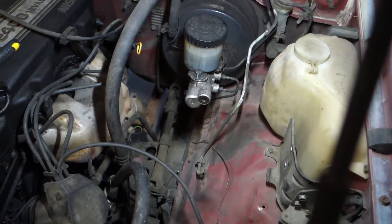You can see that orange portion right there where it goes into the exhaust. Now you can cut that and crimp it, or you can take that nut out of there — I think you can put like a nickel in there. On 240SXs it's about the size of a nickel. Shove a nickel in there and just run the nut back in. The trick is getting the nut off the pipe though — you have to cut it so that it's round so you can slide the nut off. I think what I'm going to try to do is take that nut off, put a nickel in there, and put the nut back in. It doesn't seal up perfectly but it definitely seals up enough.